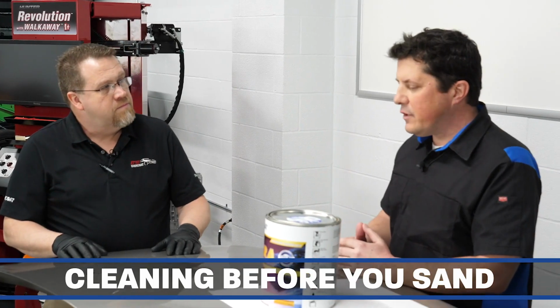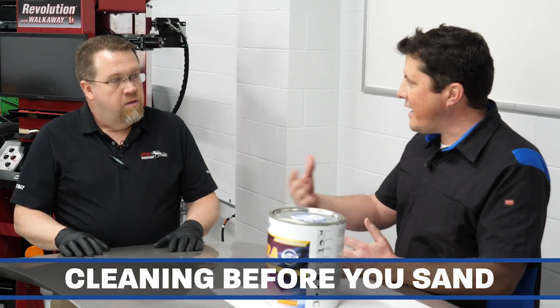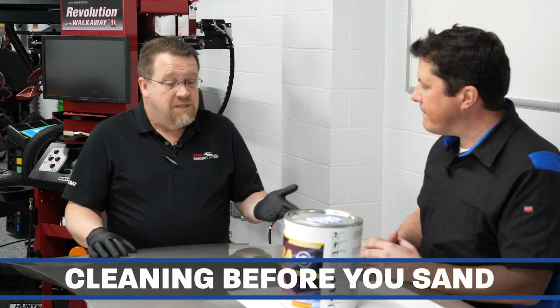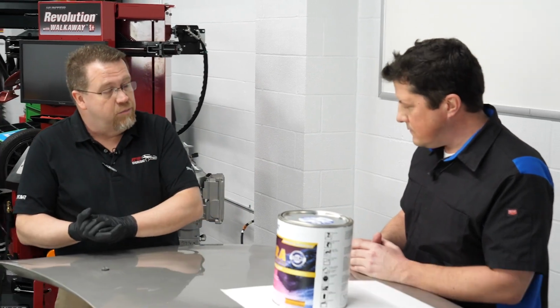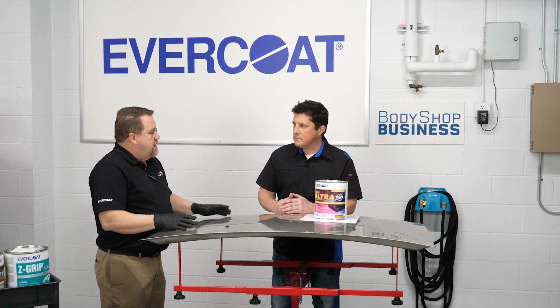Tim, one of my first questions is, why do you need to clean? Couldn't you just sand off the dirt? Well, that's a misconception actually, because what happens is the contamination that's on the surface will be picked up in the abrasives. It's a good idea to clean the entire panel.